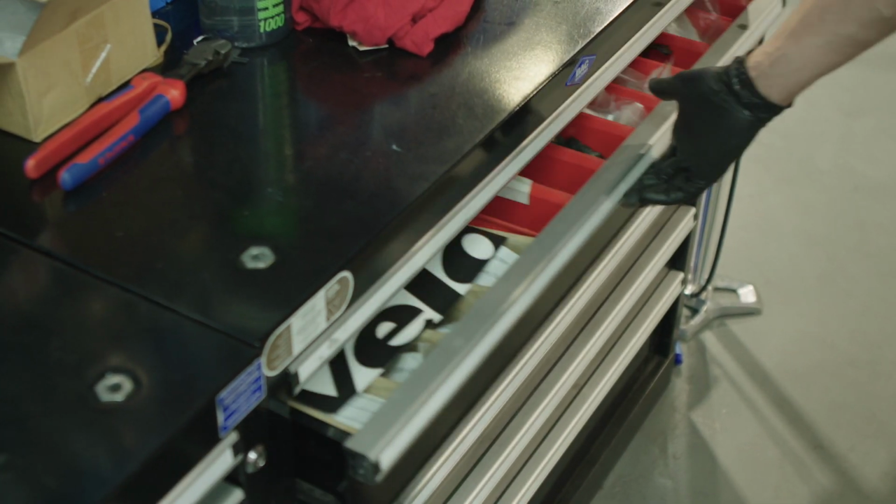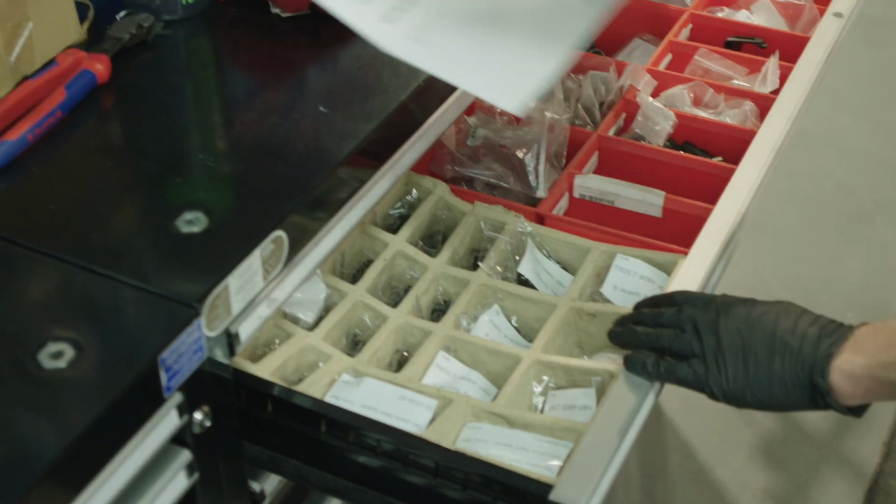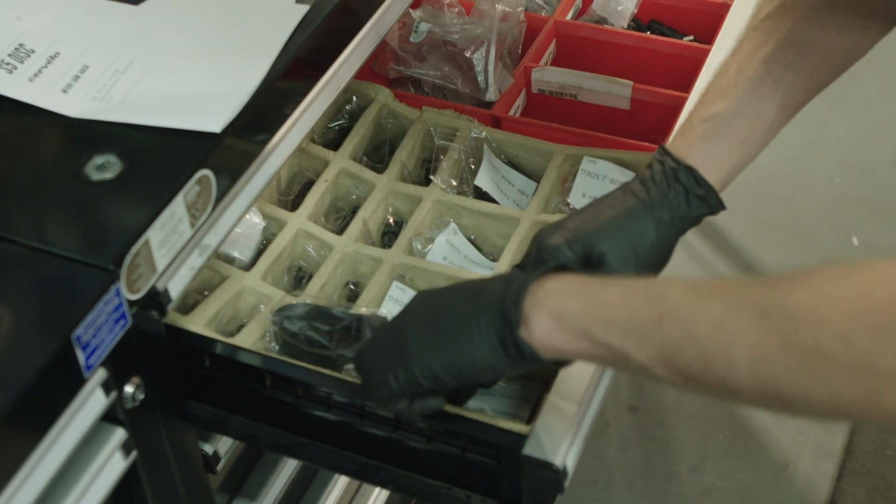Well, it looks good. But I'm pretty flexible, and from the center of the front axle to the center of the handlebars, I'm 560 mil. But I've got a little bit of wiggle room. I could actually come down a bit, so we're going to do 550 on this because it's a full aero bike. But it's good. It means we've got to raise the bars about 20 mil from the slammed position. So it's going to be interesting to watch the wedge configuration and how that affects the aesthetic of the bike. Let's have a look. Definitely. So Cervélo send us a whole package with different spacers, different wedges.